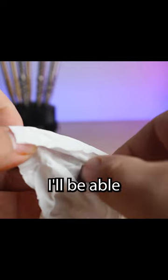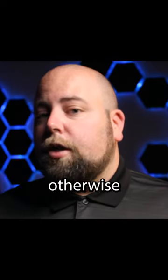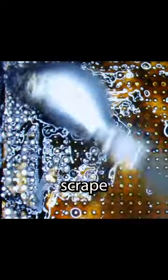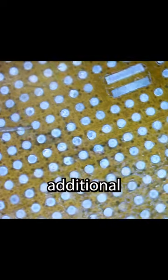I simply take it out and I'll be able to carefully remove without much effort the underfill that remains under the CPU and on the sides. This underfill would otherwise be a pain and I'd have to scrape at it with plenty of heat, subjecting the CPU and RAM to all of that additional heat.